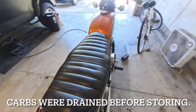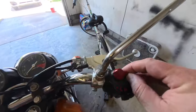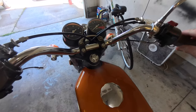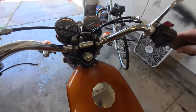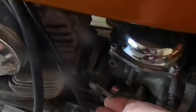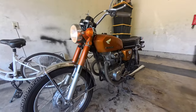Let's give it a roll. Open the petcock — we got fuel going in. Coming over here, I'm going to turn the choke on, flip that up, key on, kill switch on — let's see what happens. Wow. Get that choke off. Not bad for a cold start! Left is running, right is running. Wow — 1970 CB 350 lives again!